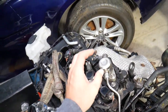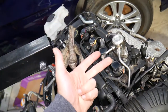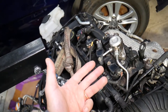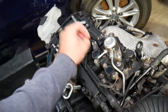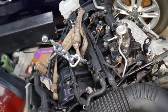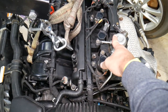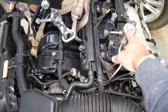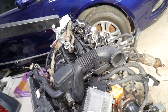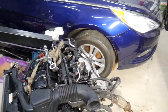Those are a little complicated to diagnose. You can disconnect the fuel hose — though I would not recommend it unless you have a fire extinguisher on hand. Make sure the engine is completely cold, avoid sparks and flames, and use eye protection and special clothing because you may spray fuel. If you remove the hose, put it in a container, crank the car, and it's sending fuel to the pump, most likely the in-tank pump is good and the high pressure pump may be the bad one. You'll need to conduct other tests as well, and we have a dedicated video on how to test the fuel pump.